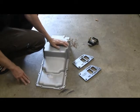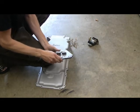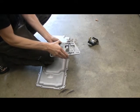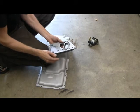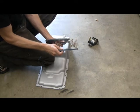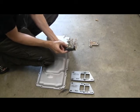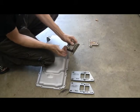How I'm going to do that is I bought another set of motor mounts — these are from Dirty Dingo again. What I put on there were slider mounts, which were two of these plates together that you could slide back and forth to get the right setback on the motor. I'm within an eighth of an inch of one of the stock holes on these non-slider mounts, but what it allowed me to do is not stack two pieces of steel, so the motor will drop down.